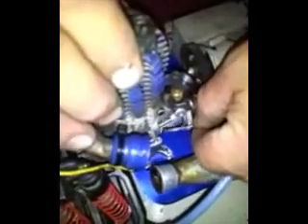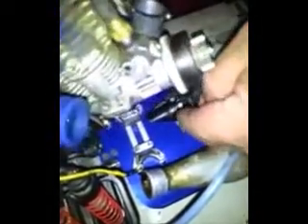Now when you place the motor back in, make sure this bar is not sticking out, because if you put the motor in you can't get this bar back where it belongs — it has to be in front. You want to come in and under, and then set your motor in. Once your motor is set in there, you want to put your ground wire back on. It's very important — don't forget the ground wire. That goes right there.